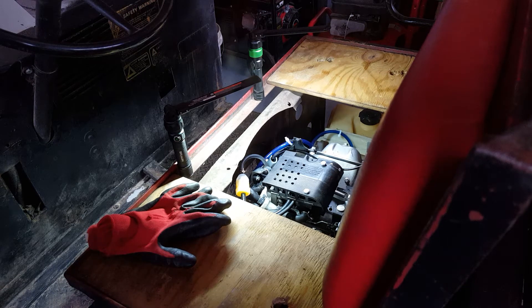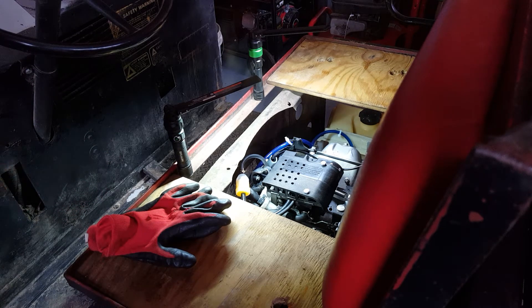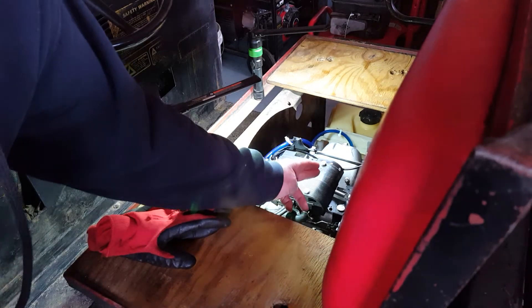Hey guys, DC teammates here. Well, I went and did it — I took out the electric pump, believe it or not. I said I was done with this, moving on to another project, but alas. It was working beautifully — you saw it on the last video. Came back to start it, wouldn't start. Went through five sets of plugs. Even with the bypass filter it was still too much pressure. Then I was watching a video by one of the guys — Computer Redneck or something like that. He said one of the pumps sold is sold in error, saying it's like one to one-and-a-half PSI. Sure enough, we've got a lemon — it's been trying to run two-and-a-half to four PSI, and even with the bypass that was still too much. You could see it actually lapping up in the throat of the carburetor on the air intake side.